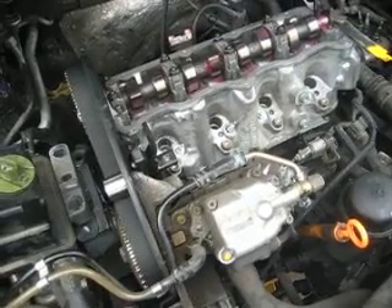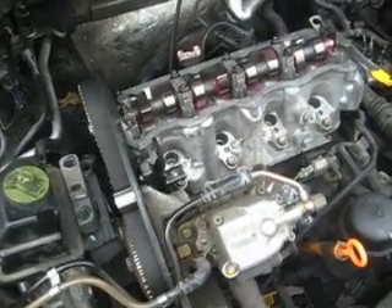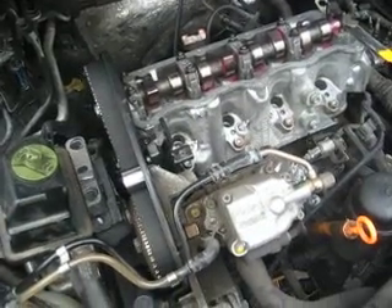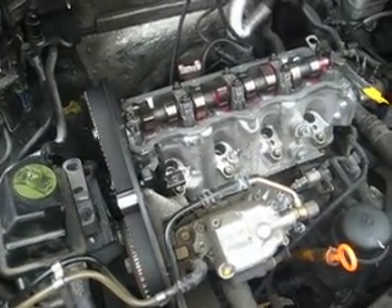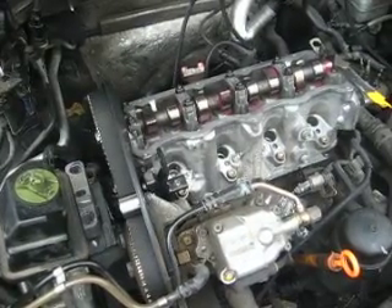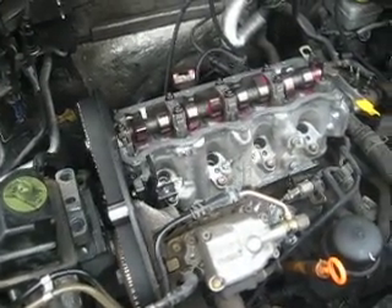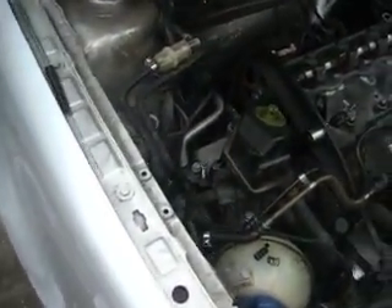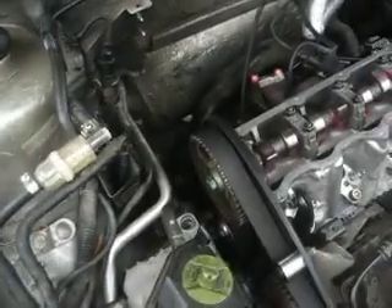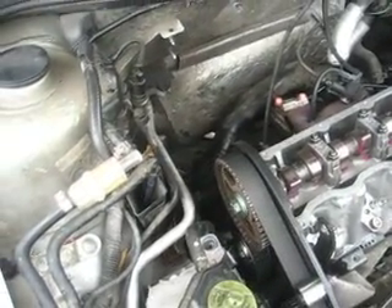I opted to go ahead and clean the VNTs on the turbo while I had it open. I actually broke the turbo. There's a wonderful guy in Ohio — I think it's XS Boost or something like that — he sells the cartridge. It's not a Chinese cartridge, he's a local manufacturer and I think he sells them on eBay. The cartridge for the 1749 — it's a GT1749V, that's the TDI turbo — this is an '03. I think he sells it for roughly $360, that's the whole kit with bolts and everything.